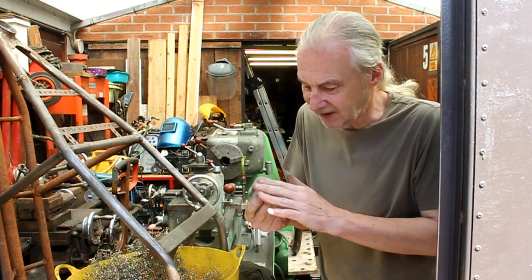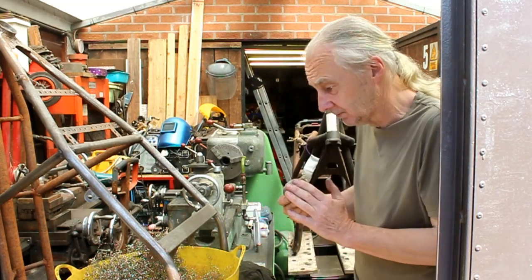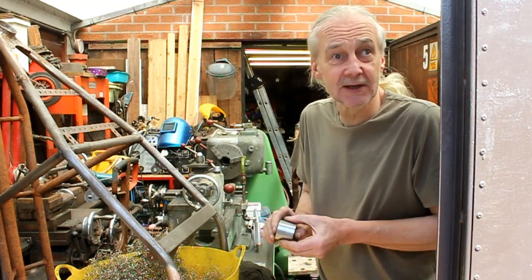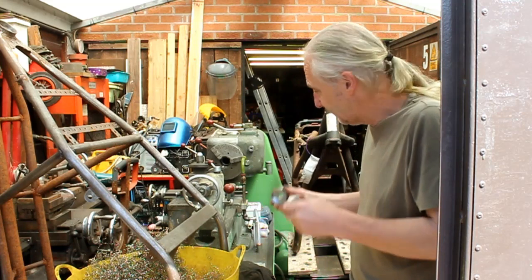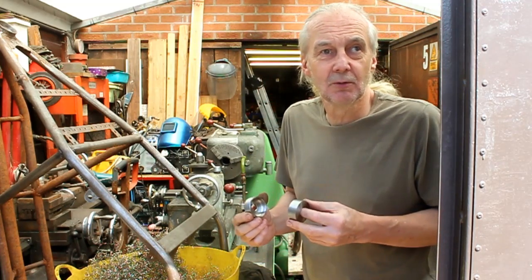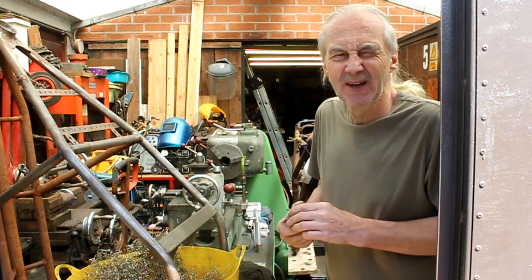So ideally they want to be on a metal face. Right, brilliant. That job's almost finished. Yes. Well, the thing is, if I machine it now to suit them, when it's powder coated, it's not going to go in. No, of course. So no problem. So you'll do it a little bit loose, and we should be okay.